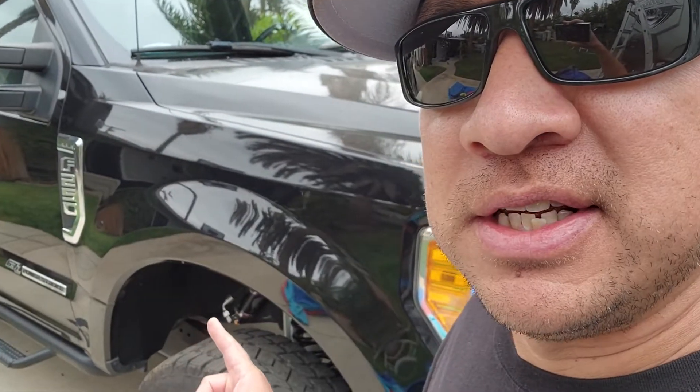One last thing — I got confirmation from Fox on these part numbers. In 2020, Ford lowered the F-250 — front by one inch, rear by one and a half inches — to make entry easier for consumers used to the older lower models. The 2017 was a taller stock vehicle. So on a 2020 and newer truck you'd need 3.5 inches to equal 2.5 inches on mine. Fox confirmed these shocks fit everything from a 2-inch to a 3.5-inch lift.